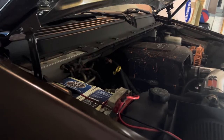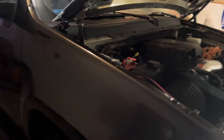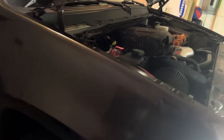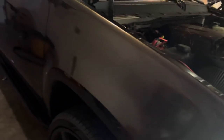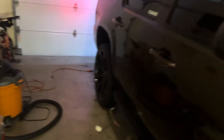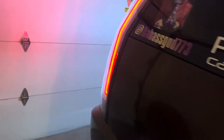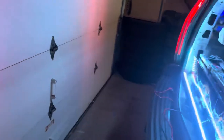But first things first, why do we get whining noise? All right, whining noise comes from various things. It can come from poor RCAs. It can come from poor grounds. It can come from multiple grounds. It can come from RCAs touching powers and having that signal get mixed in with the RCAs. It can come from loose grounds. It can come from putting grounds in the wrong place, not having a solid ground. So many different variations, all right?